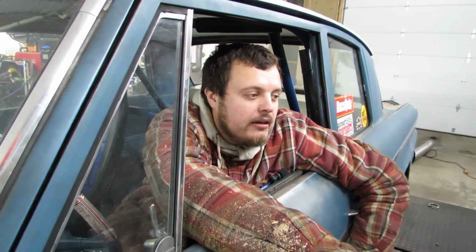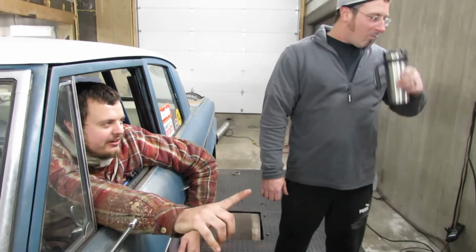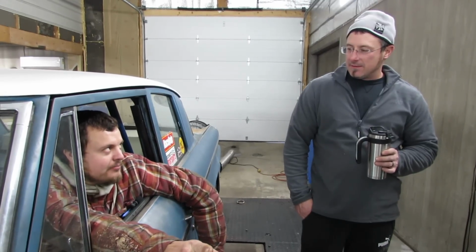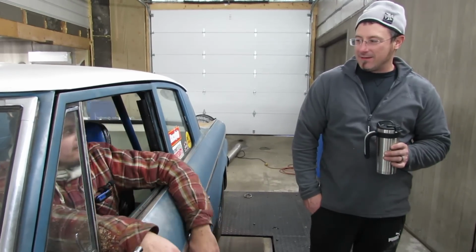I think we weren't even close to being done on the Fairmont. It's got a big retarded cam in it. It's got the 06 and later intake cam, and then I retarded it one tooth because I'm hoping it makes more power up in the higher RPMs, because I have a damper that lets me rev higher than the factory rev limiter.